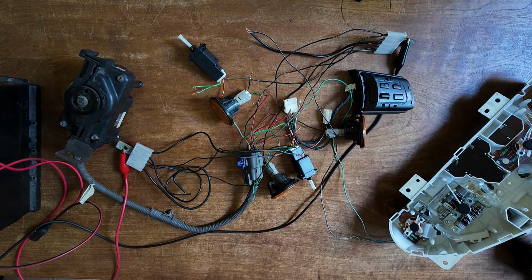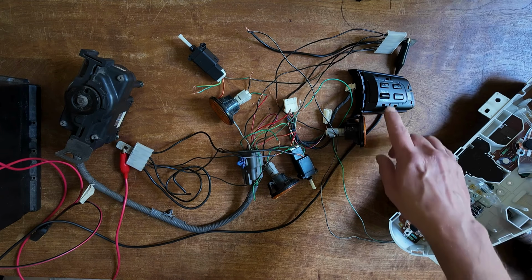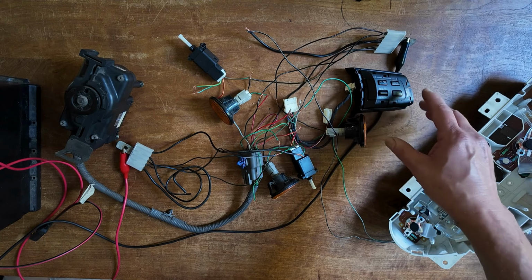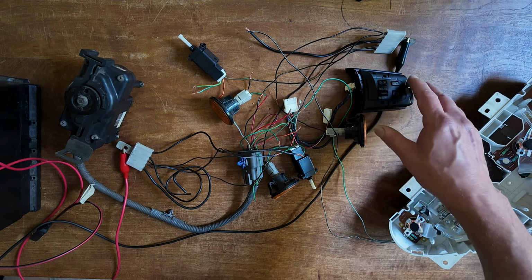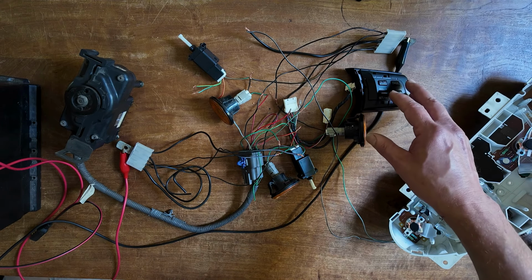What this also proves is that the vehicle speed signal from the NA cluster can work together with this Mazda 6 cruise control system. The same is true for the MX-5 NB Miata. So the NA MX-5 in Europe, that did never come with a cruise control, could use the Mazda 6 cruise control system as well, but then we have to find a different solution for the cruise control switches, which in itself is not very difficult because we have only 4 buttons: on, off, cancel, and set and resume.